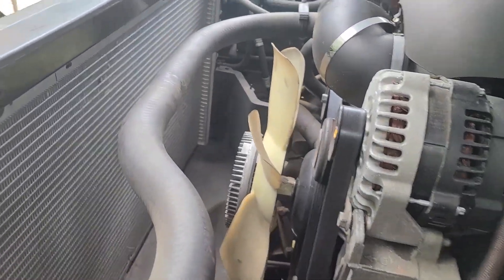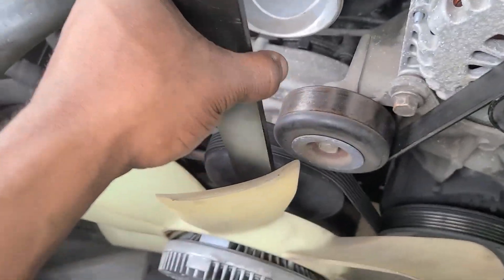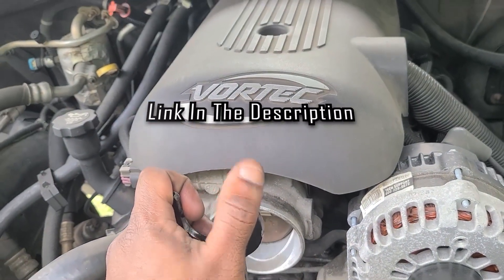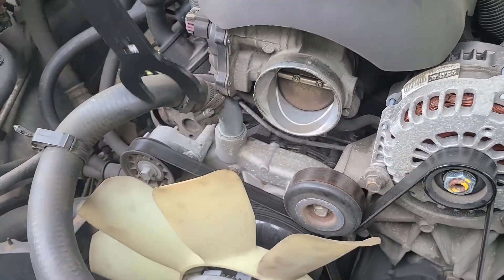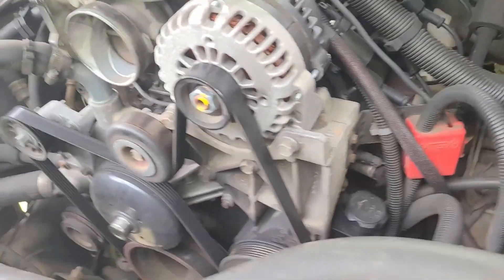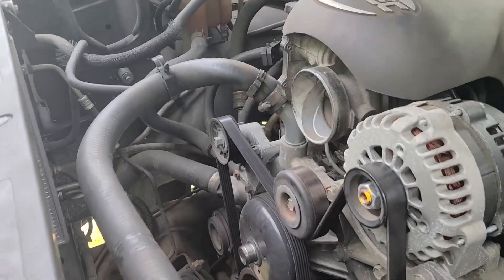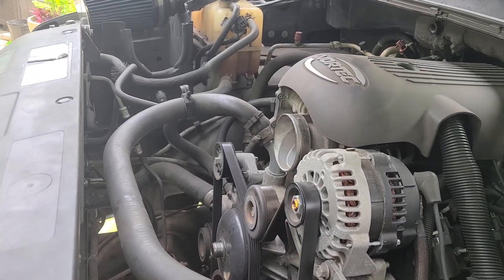You do have to upgrade your radiator to the bigger one if you're going electric fans — I've already done that. Now let me show y'all a little life hack with the fan clutch. I rented this tool — about $85 from Advance — it's a fan clutch removal tool. Take your heavy hammer, hit it, and put tension this way while you're hitting it. It'll come off every time. Look at how much extra space we got now just from removing that loud-ass fan. Happy with that already — wish we could just run it like this, but definitely can't.